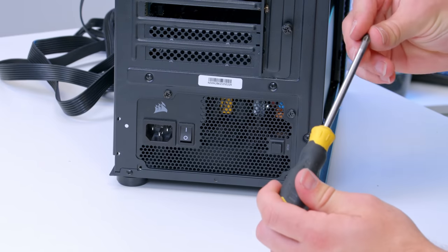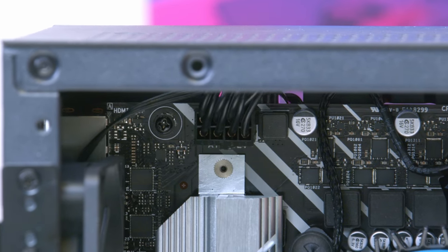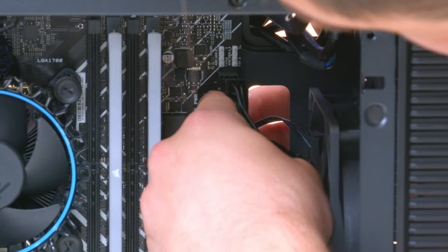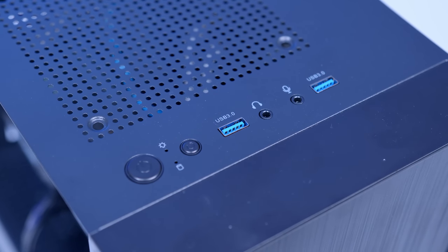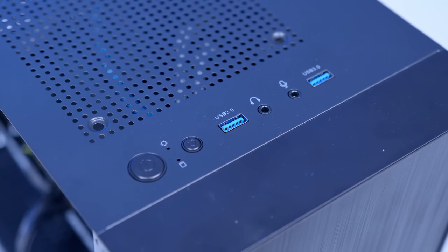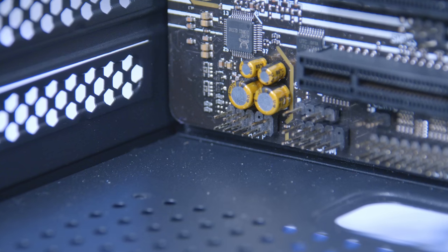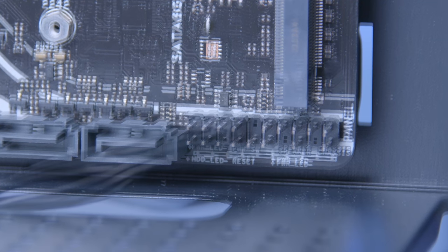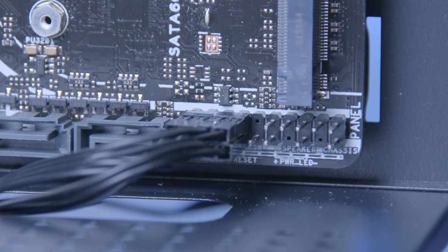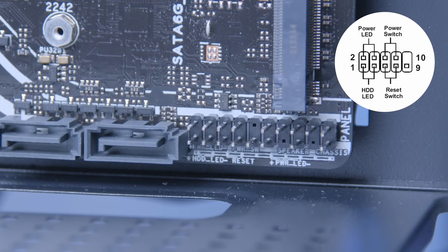Don't starve your PSU of all that juicy airflow. We're going to plug up the CPU power connection to the top left of the motherboard — that's our 4-plus-4-pin connector — and the motherboard power cable to the right-hand side. It also makes sense to do some of the front panel cables at this point. These include our USB 3 connection, which is keyed and quite delicate so be careful; HD audio, which goes to the bottom left of the motherboard powering the headphone and mic jacks; and our JFP1 pins that work our power and reset buttons. If you get these wrong, your reset button will turn the PC on and your power button will reset your PC — so if you do get them wrong, don't worry, just go back and put them in the right place.